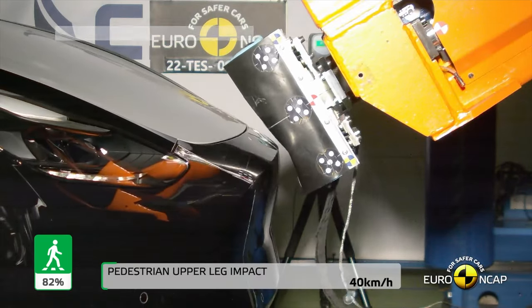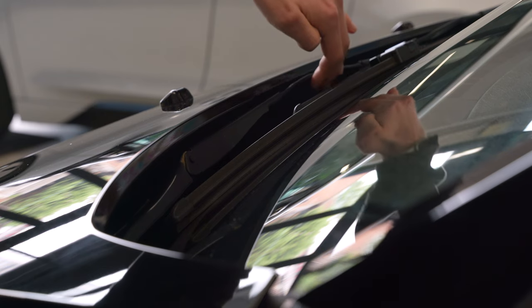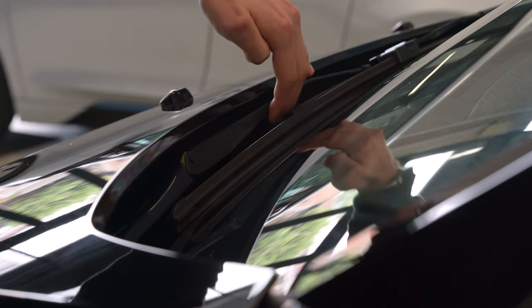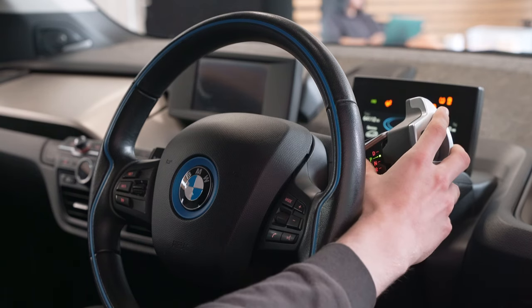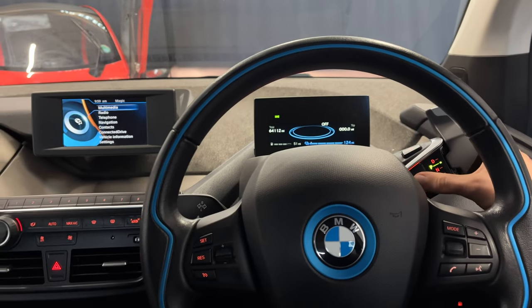But as a result, the bonnet is preventing you from lifting the wiper arms. To do that, you need to put the wipers into a dedicated service mode. Restart the vehicle very quickly — so turn the car on, even the 12V accessory mode should do — then quickly turn off, making sure that the satellite navigation display turns off as well.